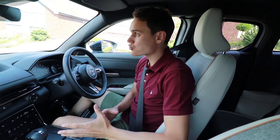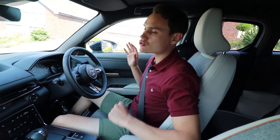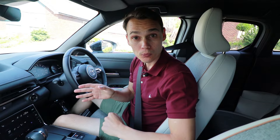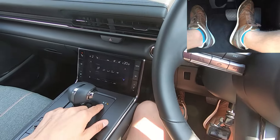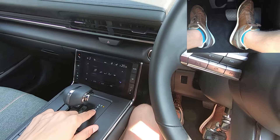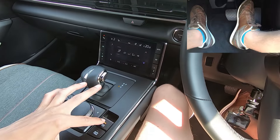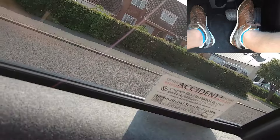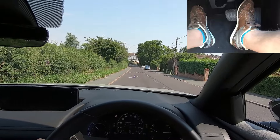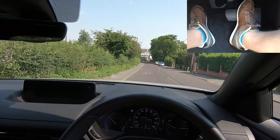So in that example I was controlling the car going uphill backwards. What if I wanted to control the car slowly going downhill? Well, it's very easy. If you want to go backwards, select reverse, and if you want to go forwards, select drive. I want to go forwards down this hill, so I'm going to select drive and take the parking brake off. Then if it's safe, all I need to do is use the brake to control the speed. Less brake, I go faster; more brake, I slow down.